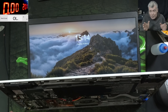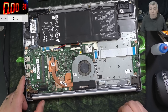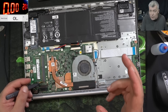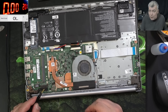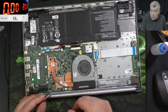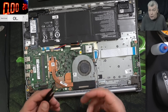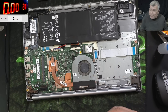Someone said is it pizza? Yeah, I told you from the beginning it's looking like a piece of pizza. You said it's not a proper repair, it's a dodgy one. You have to calculate the risk. Trying to go on the back of the connector where you have oxidated pins is kind of tricky, so I prefer soldering here. There's no reason to take the connector out. On the other hand, if something bad happened, the tiny wire can act as a fuse and blow up — so we actually upgraded the design. It's an improvement, it's not dodgy.